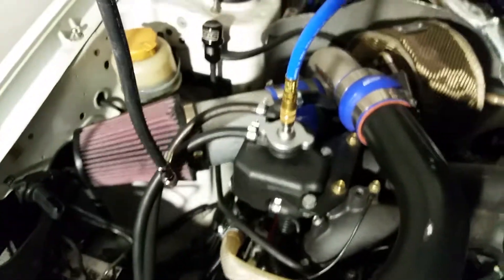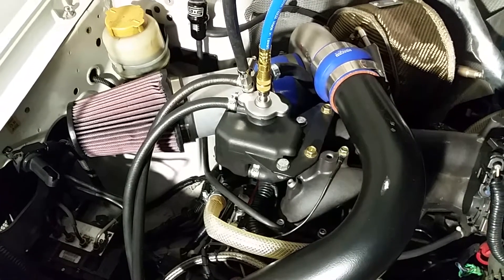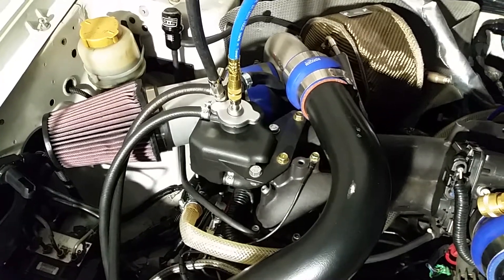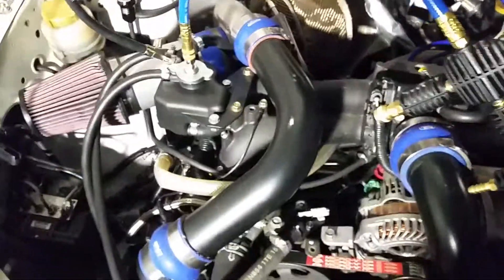One of the tests you can use is this hand pump here. What I just did off camera is I took the adapter and put it on here and put in one bar. You can't go over one bar because the caps will start opening up and dumping the pressure. In this case it's okay — the second cap is 1.4 bar, then it would let it out. But one bar is all you need.